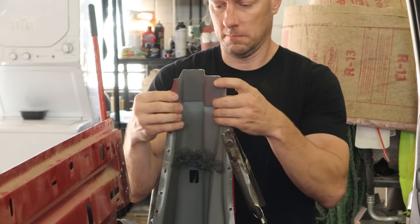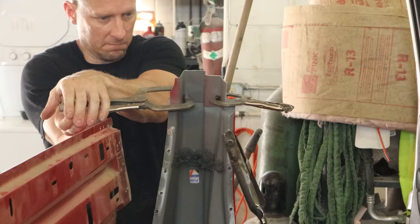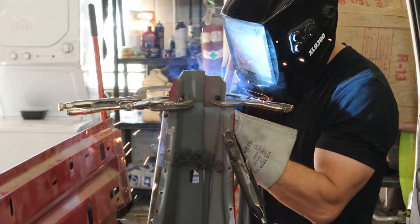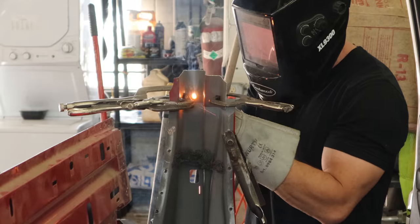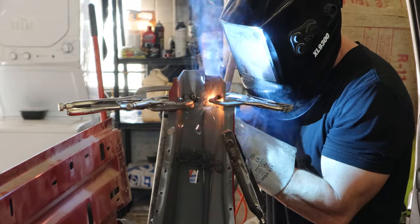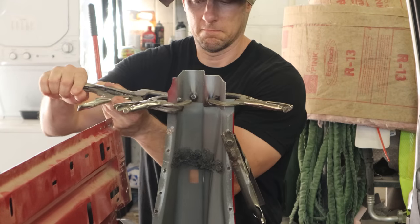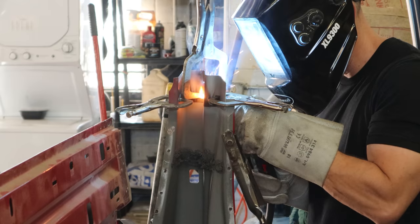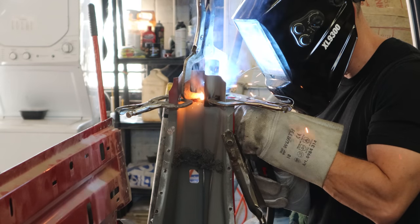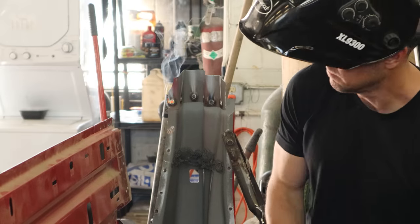So now we're going to put our backing in on our B pillar here. We just trimmed off a piece of our other one. We drilled some holes in there so we could weld through it, clamp it up, and now we'll weld it up. And you only have to worry about this video burning your retinas out if you happen to have one of those new computers that transmits UV light via the internet — if you just have an old-fashioned computer that doesn't do that, you're okay. We'll weld up all of our holes and our piece is ready to go.